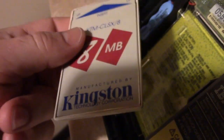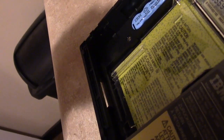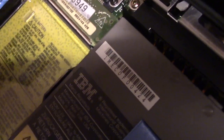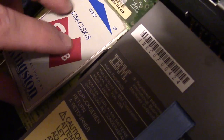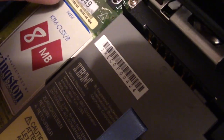So you've got your floppy drive, battery, and hard drive — it's a 250-megabyte drive in a proprietary caddy. Let's take the floppy drive out. Underneath the floppy drive you've got your RAM expansion. This has a very early Kingston RAM expansion module. A lot of early laptops had expansion cards like this. I believe these are fairly proprietary. There's also a little plastic tray here. This keyboard was actually built by IBM's Lexmark division — it says it right there. Lexmark made most of IBM's keyboards and printers for quite a long time.